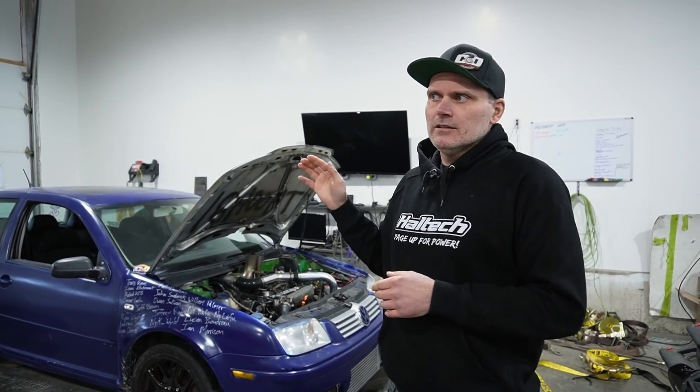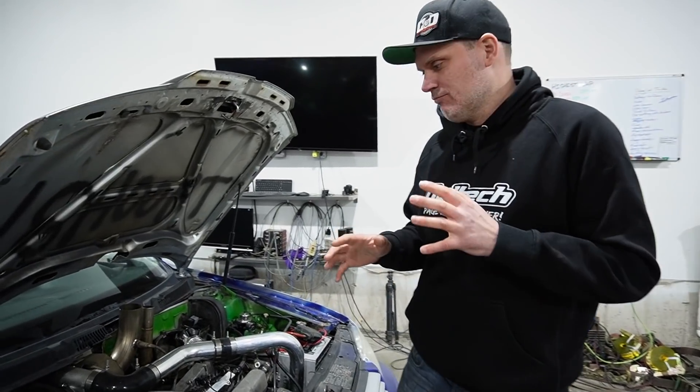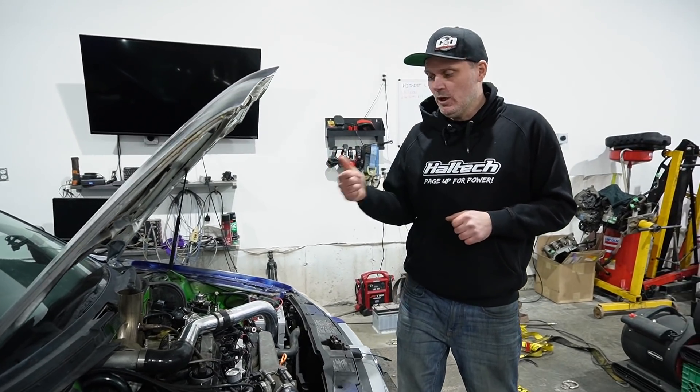Speaking of things breaking — talking about the transmission if we try to drag race it — I'm at the point now where I'm going to touch on a few things that are likely to fail. A couple of things for sure are going to be the first to fail: one is we bend or break a rod, which is going to be pretty common. Two is the rod bolt itself failing. Another thing that's potential to fail — not really so much horsepower related, they kind of just leave the chat when they want — is the exhaust valve. That could literally happen at any time; we drop a valve and that'll destroy it for sure.